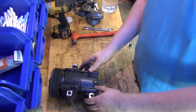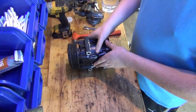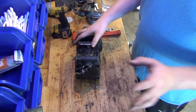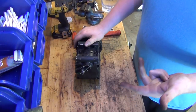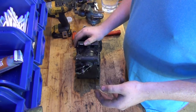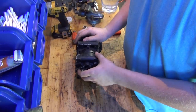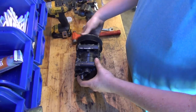So, plan of attack. I've already got the truck set up with a wiring harness to plug into here. And then everything else in the truck is new. It's got a new evaporator core, AC condenser, new accumulator. I think it even has a new orifice tube. The only thing I have to do is reseal the box. I didn't put new gasket stuff on, so the airflow is not as good as it used to be, so I have to fix that.